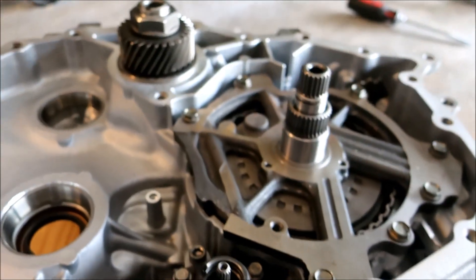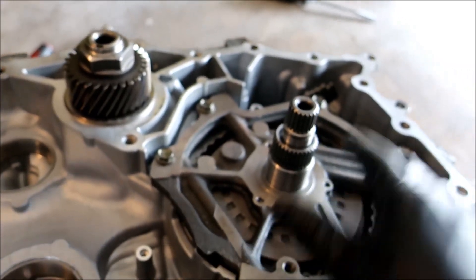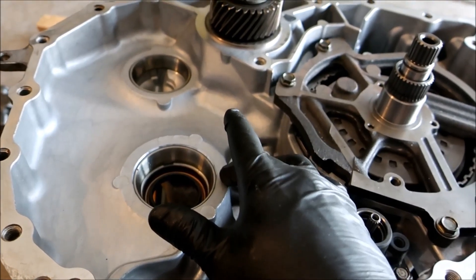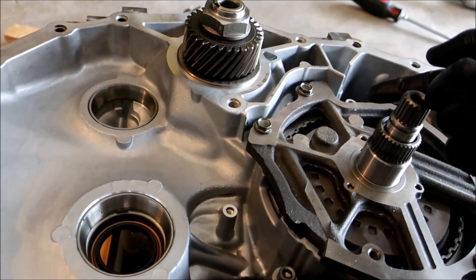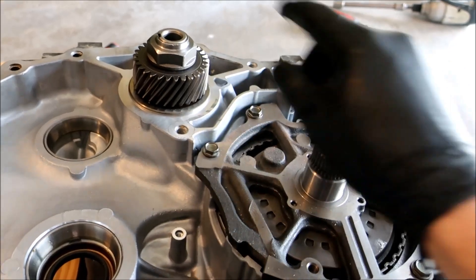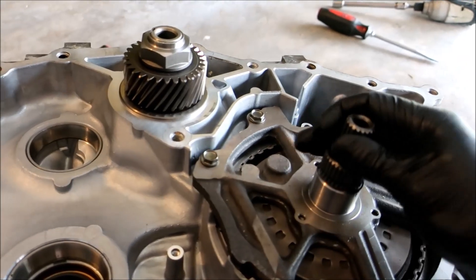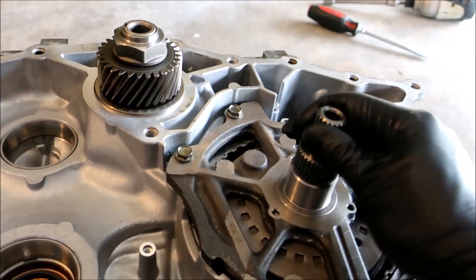Up here whenever I spin the input shaft there's a little bit of a stiction effect going on, so it looks like we're in gear but we're not. When the forward clutch is engaged, this is going to be the output from the CVT, then it goes to the transfer gear and then the final drive assembly, which goes to the front wheels because this is probably front wheel drive - a 2014 Mitsubishi Lancer. When I spin the input shaft with the forward clutch engaged, you can see the rotation of that gear coming off the secondary CVT pulley going that direction. When I engage the reverse clutch pack you can see it reverses its rotation, then I go back to the forward clutch assembly.